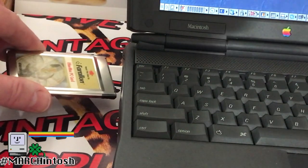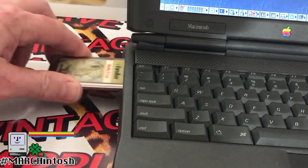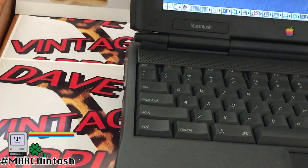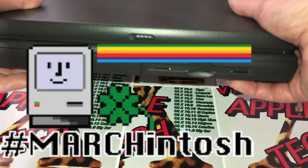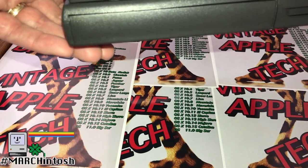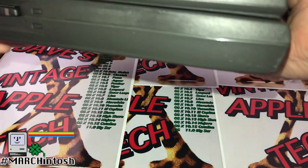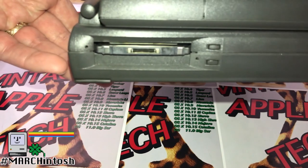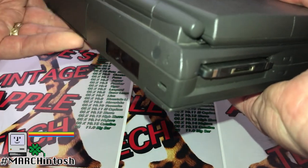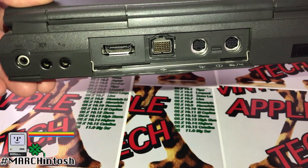Faster models with a small L2 cache and 8x CD-ROM drive were also released. This machine came in a passive matrix display, which identifies the CS model, and an active matrix display, which is the C model. It also has one ADB port, one serial port, one SCSI port 30-pin, one display optional mini 15-pin port, one infrared port, audio in with one 3.5 millimeter analog input jack, and one built-in microphone.